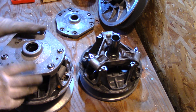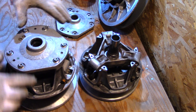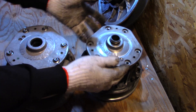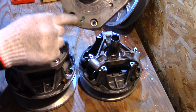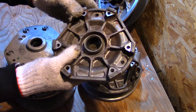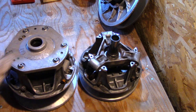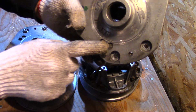These clutches are timed, which means they have to be assembled a certain way, because this face plate will physically fit on in any direction. They are timed because they are weighted. Right there are the factory timing marks. The reason these are timed is actually because of the weight — they have to be a balanced clutch to get maximum performance as well as to prevent wobbling, just like tires on a car have to be balanced. That's what these drill holes here are for — that's part of balancing the clutch.